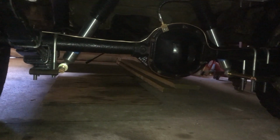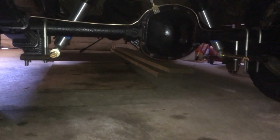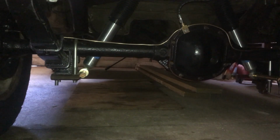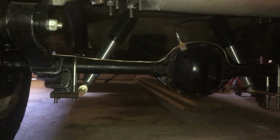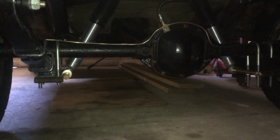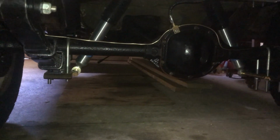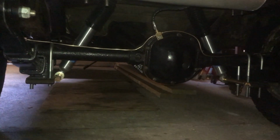And after doing some reading and whatnot, I would like to change my oil today, so you'll see that. I'm going to be running 10W-30 synthetic, and I'm going to put in an oil additive. I'm going to use Lucas ZDDP Plus, which is good for old cars like this that have hydraulic flat tappet cams, and that allows them to stay lubricated, which sounds kind of funny because it's a metal, but it adds a protective layer to your camshaft. So we're going to do that today, and I'll show you what that involves.